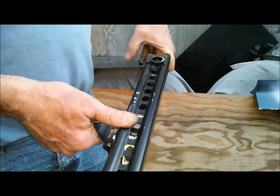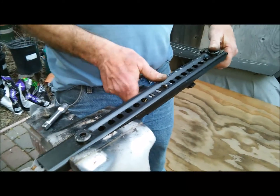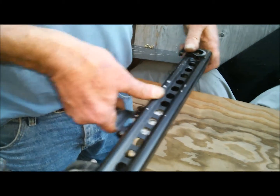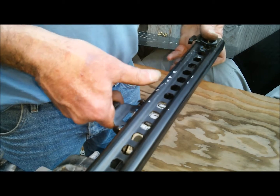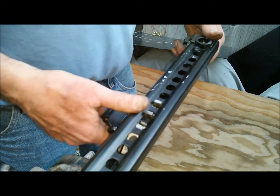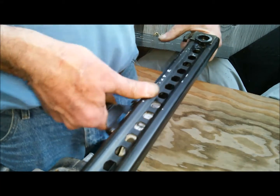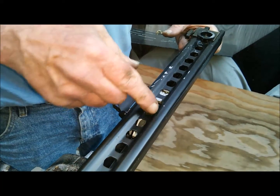If you've had trouble with your Mini Cooper's seat rail and it gets stuck — you're not able to get the screws out — it can be a tough job and it's hard to see what's actually going on. Here's what's going on: there are four poles and this lever right here by my thumb. The mechanism pushes down on it, and when you let go it stops the seat in position. These poles stick into the holes here, and when you push the mechanism down — the handle for the seat — it pulls the poles against the spring so that you can move it. Then when you let go, the spring pushes them back in.